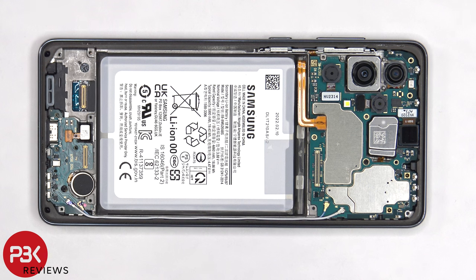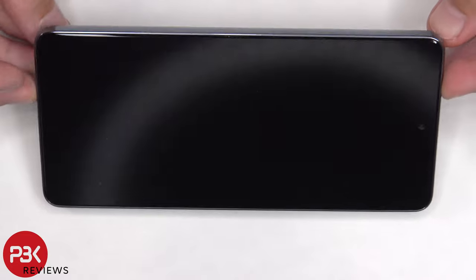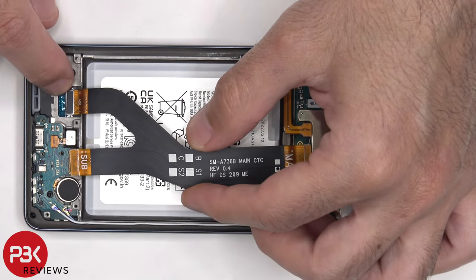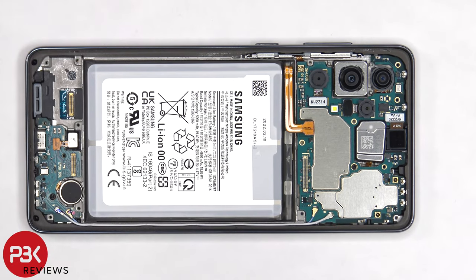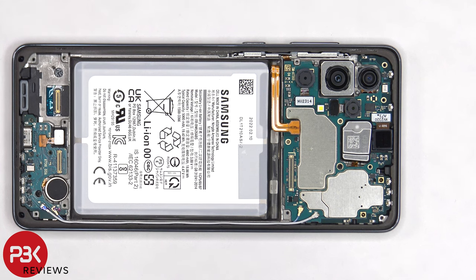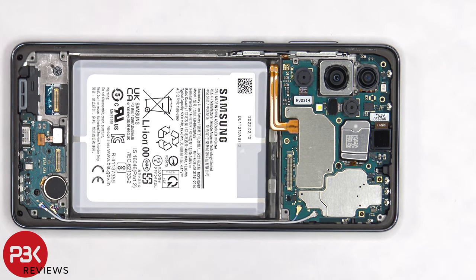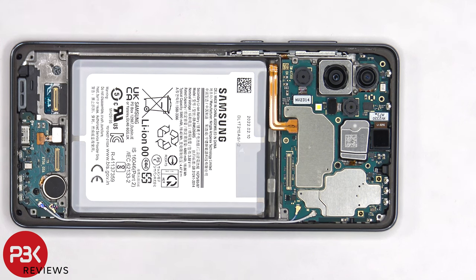For screen replacements, you would be able to replace the screen without taking the phone apart. You just have to heat up the front of the phone where the screen is and pry the screen portion off, since the flex cable for the screen has a connector underneath. Once you've pried your old screen off, apply new adhesive and seat the screen back over the frame, making sure the connector on the screen reconnects with this end of the flex cable. But if you're having issues seating the new screen over the frame properly so it's aligned with the connector, you can always remove the back plate and the screws on the bottom speaker assembly, remove the speaker assembly, and connect the flex cable to the connector of the screen that way.